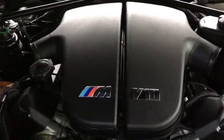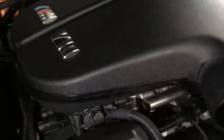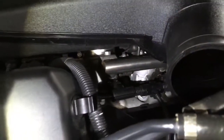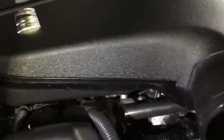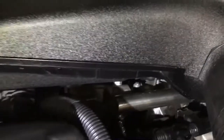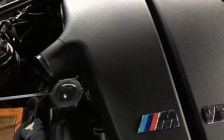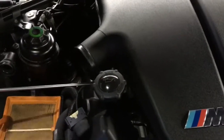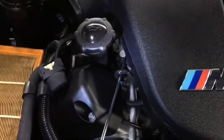The hose clamps are quite awkward to get to, so you'll have to get creative with your screwdriver and your socket extensions. Hiding away under there. Now if you look here on the seam of the intake plenum, there are some marks there, just raised up. You see 2 there. They give you a clue on what angle to get at them, but we'll have a look at that now. So I'll go through in order of the cylinder numbers, give you an idea of what angle you need to be getting in at. So there's number 1, number 2, straight through the engine lifting bracket there.